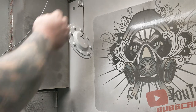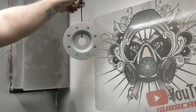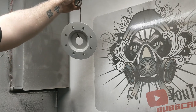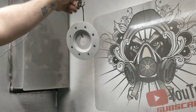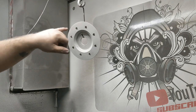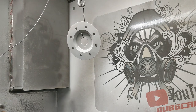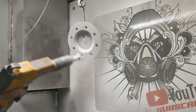Okay, so with these plates, I always hang them through the center hole. That way your hook mark is going to be covered by the center cap, or the center logo that we took out earlier. You can run it up through one of these other holes, but you run the chance of it touching the face, and that sucks, obviously. So you throw in powder on these and get them in the oven with the faces.